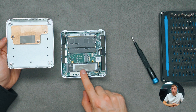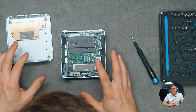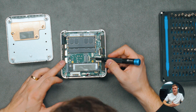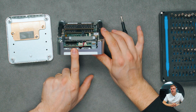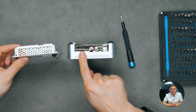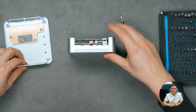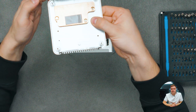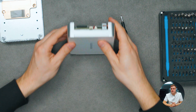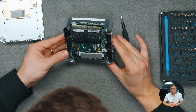Inside there's a small heatsink on top for the M.2 SSDs. There's a second slot available — 2240 size, which is not a very popular M.2 option. There's a Lexar M.2 NVMe. There's also a SATA connector which means you could connect a 2.5-inch SATA drive, but there's no space. Interestingly, there is actually an SD card slot on the board but there's nothing cut out on the chassis — no slot. Did they forget that? They must have — you can see the Kensington lock is cut out but the SD card slot on the chassis is missing. Testing the SD card and it absolutely works. Very odd.